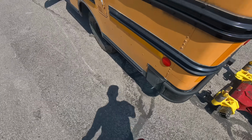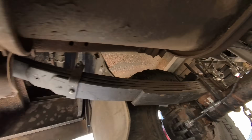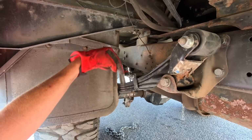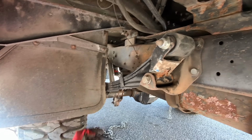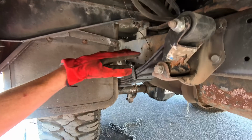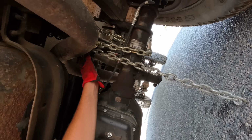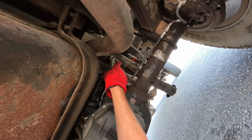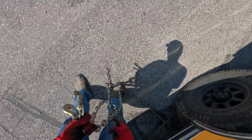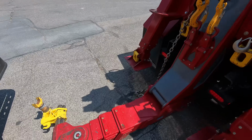Okay. Now I'm gonna grab, before I forget, my axle chains here. These big lift springs have so much droop in them, and they're such a high arch that when they droop down, this comes forward. When I was hanging the axle from it, when I originally towed it, they got right to the point, but they didn't flip over. But bouncing down the road might have been enough to cause them to flip, so I just chained the axle up. These go up in the headache rack of the truck.